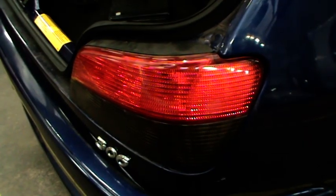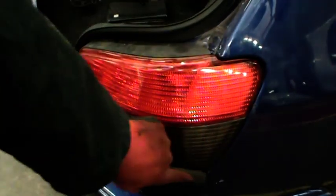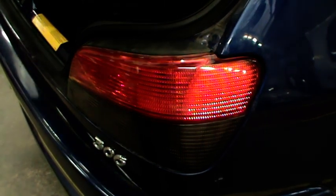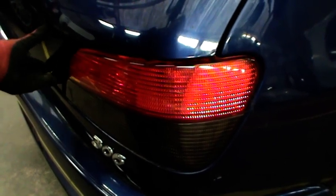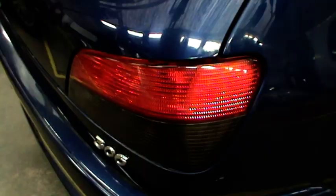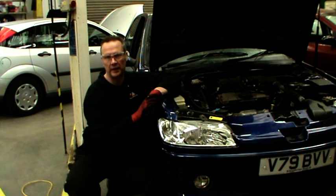As you can see it's all back together again now. The final check to do is an alignment check to make sure the shut lines all look good - nice and even, the same on both sides, that gap is even. And then as you bring the tailgate down, just bring it down slowly - don't slam it down to start with - and just make sure that it fits in nicely and that the light isn't out of alignment. Because the possibility is that if you drop the tailgate down quickly you could end up catching the light if you haven't got it back in properly. So that's the unit 153 vehicle lighting assessment completed - both the back and the front of the vehicle checked thoroughly, tested and rebuilt.